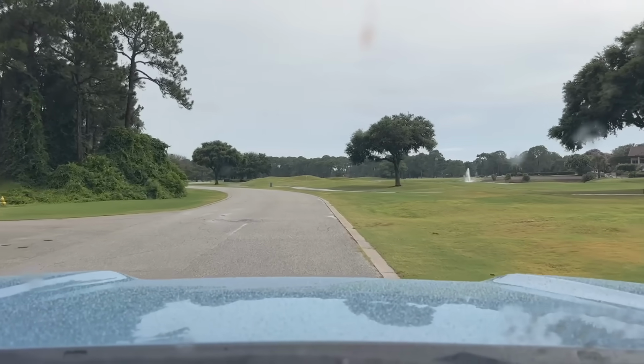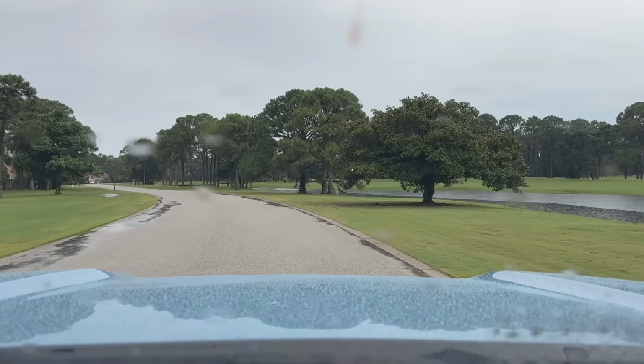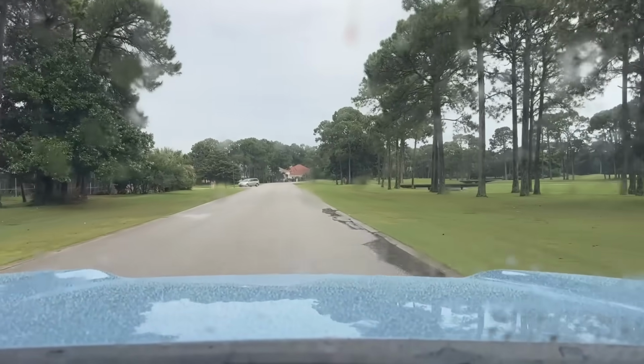So for me doing that in the Tacoma or the 4Runner, I would hear a little bit more pop at the end, a little bit more of that blow off sensation basically of the wastegates letting go. And that's getting up there in the RPM. So the sweet spot is around the 1700 RPM point where the peak torque is coming in of the Land Cruiser. So right now I'm at about 1200 RPM. You hear that low rumble.